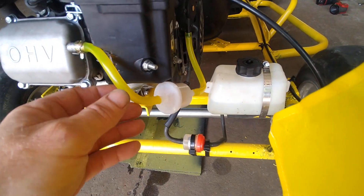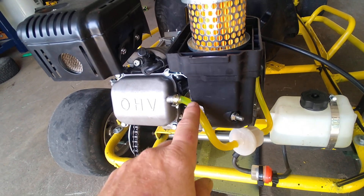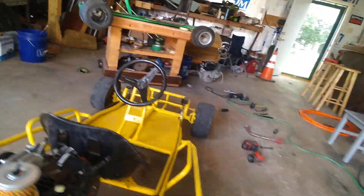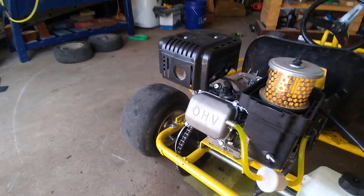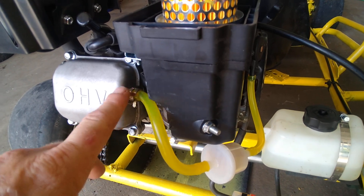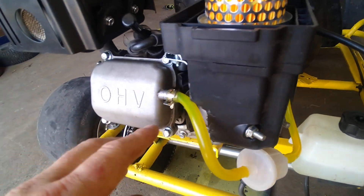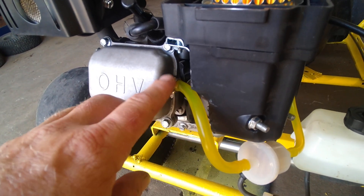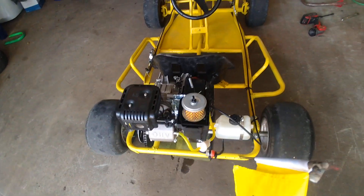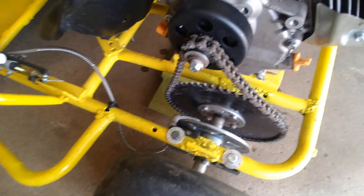Tip-top. What I like about these Hemis, guys — that's your pulse right there. All you gotta do is hook it right into that thing, boom, and that runs your pulse pump. That'll fill you up anywhere — you ain't gotta put no holes in your block or anything like that, just plug it right up to that. It's a lot better with these Hemis. The non-Hemis kind of got an issue where you got to stuff the hose in there so you really don't get a good seal on it. Got a 40 roller chain on there — big old thick one, tired of snapping chains. Got our hydro brake, it's pumping, looking real good.